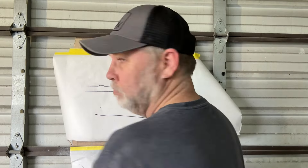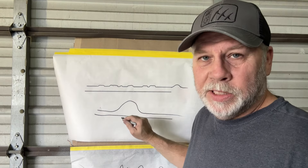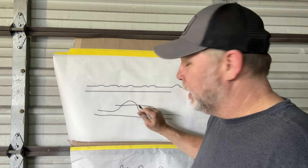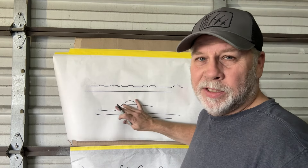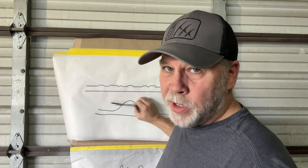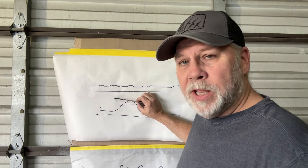Now that being said, let me draw an exaggerated run on the same horizontal plane. That's the profile of your run. If it's big enough, sometimes I'll slice the top off of it with a razor blade — I'll just cut it. You've got to be careful; if you cut too deep, you're messing up from the get-go. So I'll take just enough off to make it a little easier. If it's tall enough, I slice off some just to give me a good starting point. The grit that you start with is up to you. I started with 600 on this — kind of aggressive, but I want to be aggressive. If you start too fine of a grit, it takes so long to bring it down you're going to hit around it. If you use a coarse grit, you get rid of the high spot faster. At some point you have to switch over to something finer and slowly step up your grits to get rid of the scratches from the previous step.